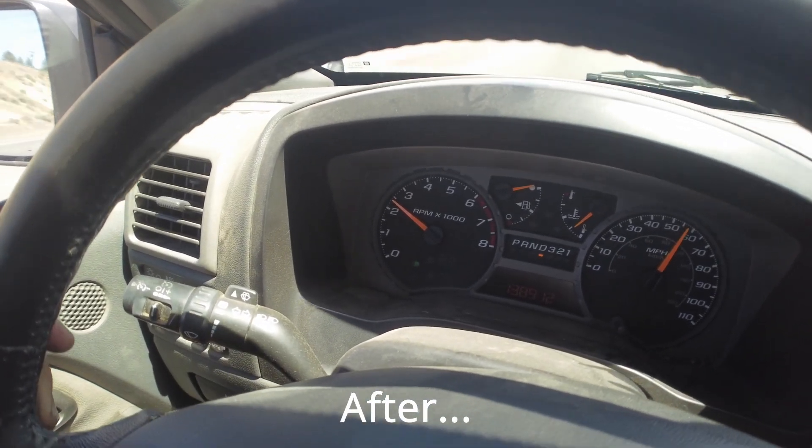It is quiet in here — holy crap. Use the link below for the Excel sheet — I fixed the five-cylinder formula. So if you have a Colorado or H3 and want to do this modification, or ask your local exhaust shop to put a quarter-wave resonator on your exhaust system, you can use that calculator. It stands to reason you could do this for multiple RPMs on the same motor, because one tube will only cancel one frequency at a given RPM.